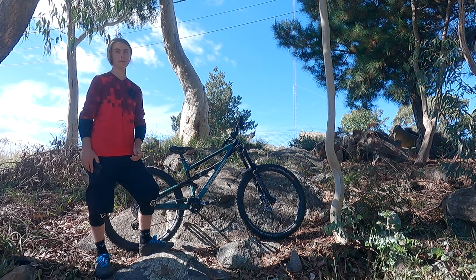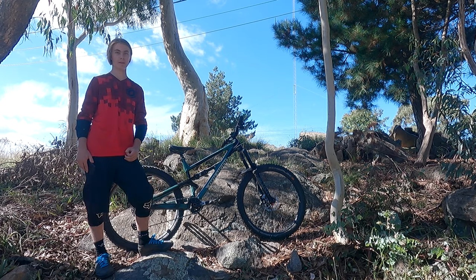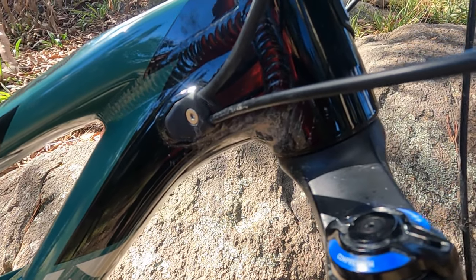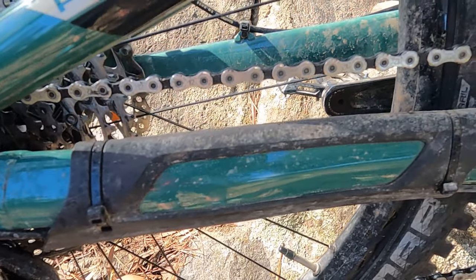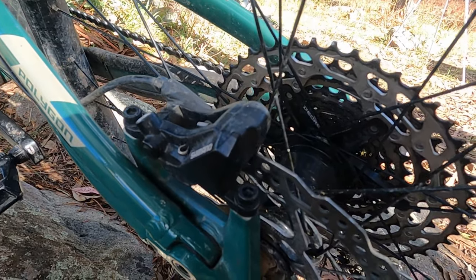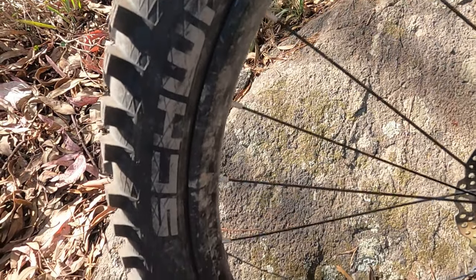Because it's so progressive, you could put a coil shock on this bike with some of the money you save from buying it instead of the more expensive options. Internal cable routing for all of your cockpit keeps the nice neat look, and integrated chainstays keep the noise down and also help with cable management. The rear axle is a 12x148 boost width, which allows for wider rims and tyres, giving you more grip and stiffness.